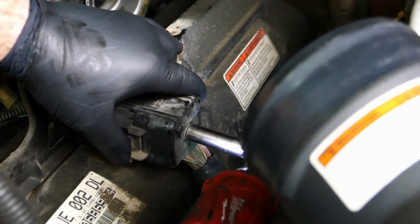We're down to valve cover bolts. So we're just gonna walk around the valve cover. The first two we're gonna take off are the bracket for the 42-way connector. And there's a significant amount of torque to them, so you'll have to put some muscle into it. And then once they break loose, they're no problem. Now we should be able to lift up that bracket and get that 42-way out of our way. I usually just fold it back out of the way under something.